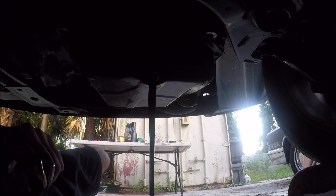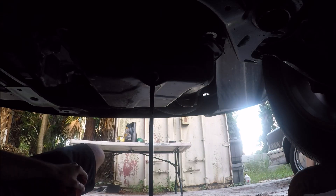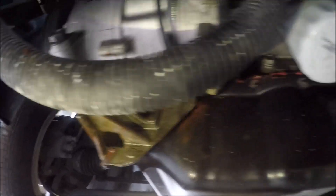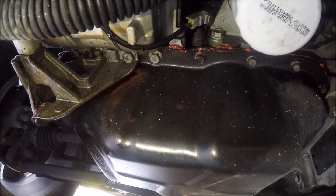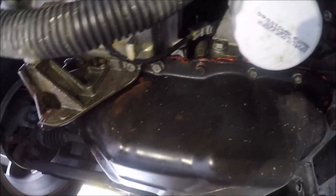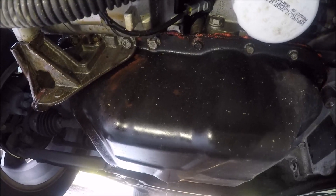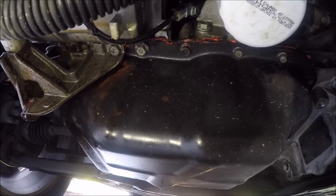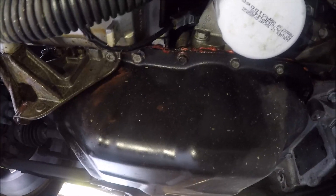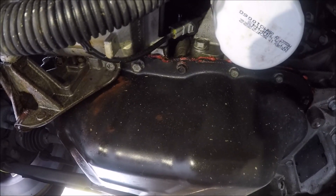We're going to let that oil drain now. Make sure you hang on to your drain plug and don't lose it. While that's draining, I noticed we have a small oil leak coming from the oil pan — you can tell there's a ton of RTV on it that somebody tried to use. They probably did it at the dealership. An oil pan gasket is definitely something you'd want to take care of so you're not leaking oil all over the driveway. We might just take care of that on the next oil change so we're not draining oil we just put in.